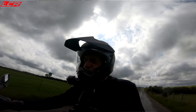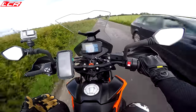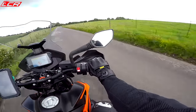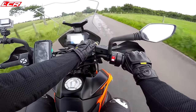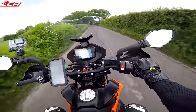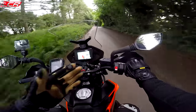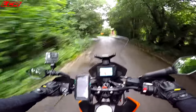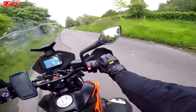One thing I have found though is a slight quirk — I don't know if it's because of the two big separate fuel tanks. They must be linked in some fashion, otherwise you'd get one full and nothing in the other. What I've found is that sometimes if the bike's been left on the side stand, it will say you need fuel. At the moment it says I've got low fuel, but I haven't — it just takes a little while for things to balance out and correct. So if the bike suddenly says you're running out of petrol, wait a little while — it may well change its mind.